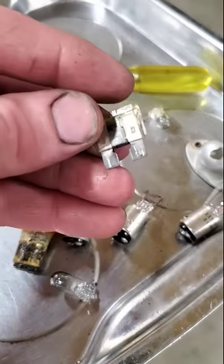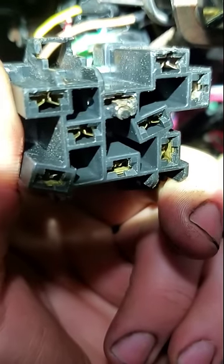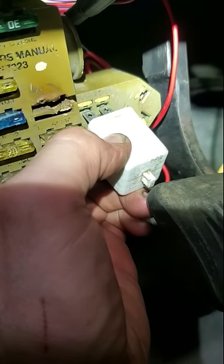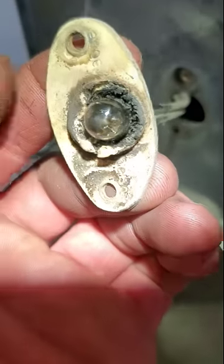The fuse was blown for the lights. Both headlight relays were blown. The headlight connector power supply pin is starting to melt. The fuse for the instrument cluster lights is blown. The flasher relay is stuck closed. The horn relay, which shares power with the lights, is also stuck closed. And it has numerous melted bulb sockets.